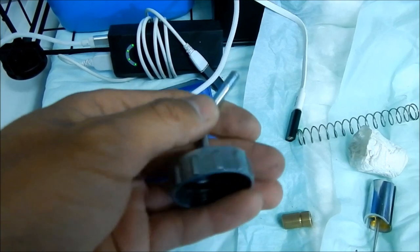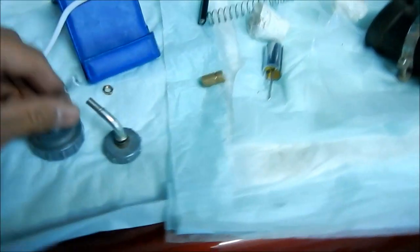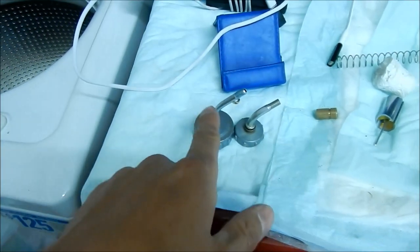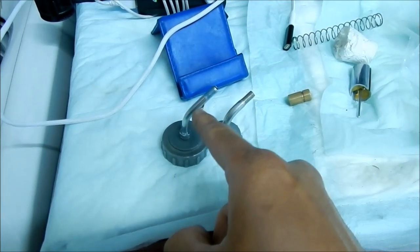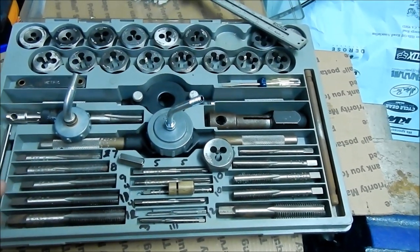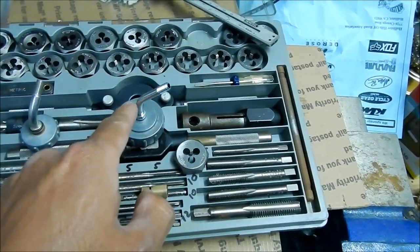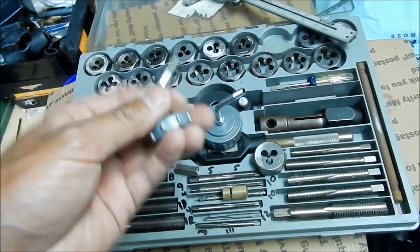Maybe about a quarter of an inch — something like that. If it's still not long enough, we can shorten this side and do the same thing on the other side. I also don't know if it's gonna clear the gas tank, so it would be better to make it exactly like the other one. This one is just about a quarter inch longer. I could not find the die or the tap for this — it's a strange fitting — so I think what we're gonna do is re-thread everything: re-thread the cap, re-thread the elbow, and cut this down a little bit to get a little extra cable.